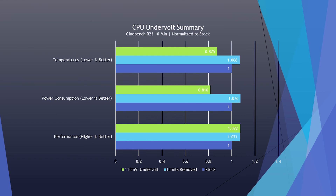Laptop manufacturers will argue that they tune the CPU to be as fast and as cool as possible themselves and that users should probably just stay away from that. And in most parts, they're correct. But having that functionality when you absolutely need it — like when your laptop is literally thermal throttling — should exist. And even if they don't recommend it, they should at least have support for it. There are dangers to it, as with any modification to your system. But an undervolted system is often cooler and in some ways even more performant than normal ones — a golden combination that most people are willing to strive for.